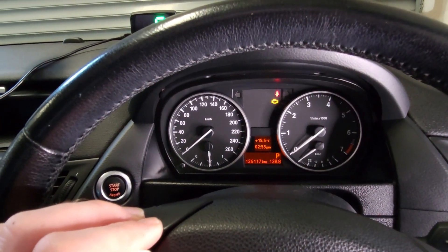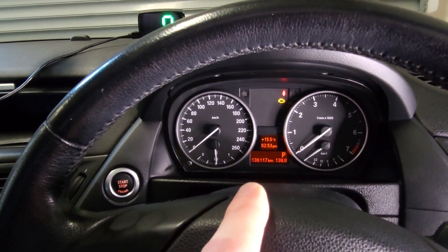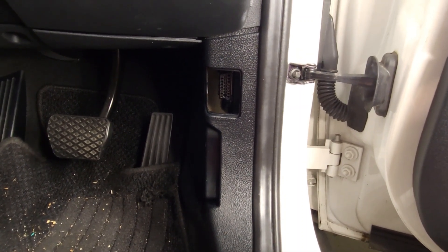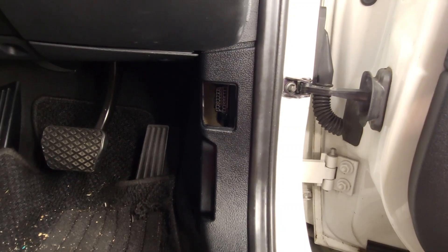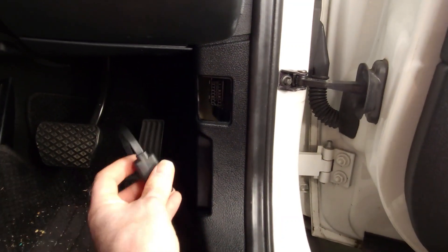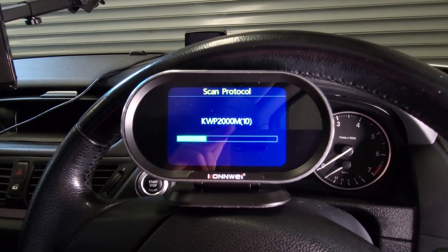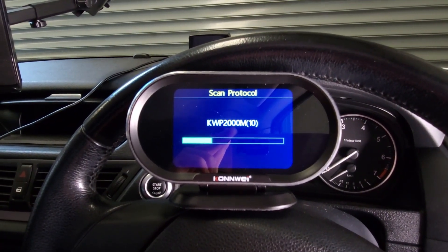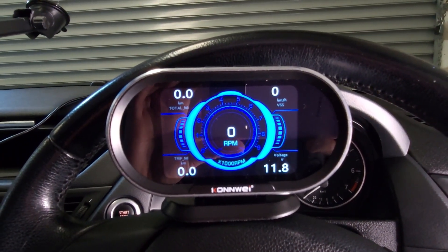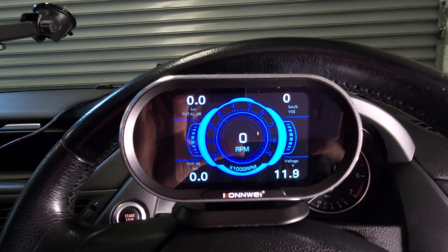That's great especially for cars like this BMW which does not have a temperature gauge. So the first thing you need to do is locate your OBD2 port — on this BMW it's on the right-hand kick panel — and plug the HUD into it. The device will then scan the car, trying to figure out what protocol it's using so it can connect. After detecting the correct protocol, you'll be looking at the main user control panel on a beautiful, vibrant, clear 3.2-inch TFT colour display screen.